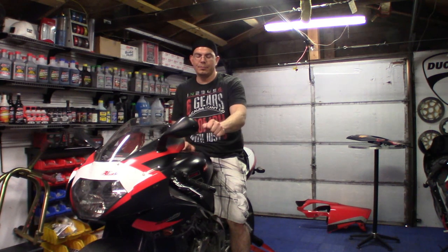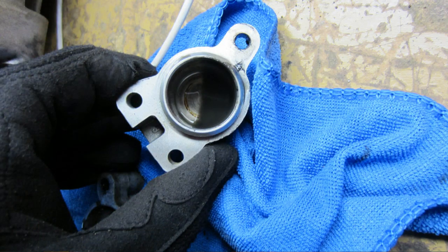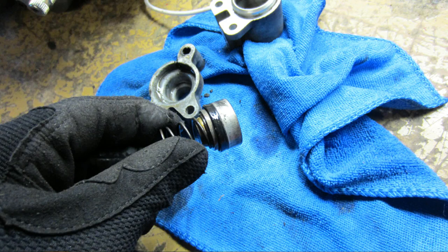Okay, so if you survived this lengthy video, you can see that doing the entire process like I did actually worked. It really made a clunk there that first time I used it, but other than that, the response that I have is tremendous compared to what I had before. I've got a few pictures that I took of that old master cylinder that I'll throw up. That old master cylinder, slave cylinder, was so worn out and nasty, and both the seals were starting to break down. The one on the shaft started swelling up, and the one on the inside is totally broken down.